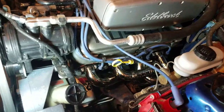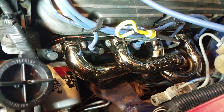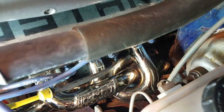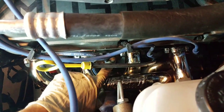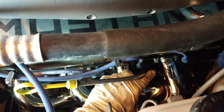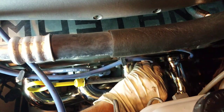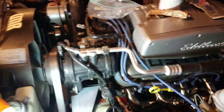We are done on the driver's side — headers all bolted on, got the new plugs and wires, and the dipstick on there. Everything fit well. Once we loosened up the H-pipe underneath, we were able to get it lined up. We'll wait to tighten up all the exhaust underneath until the other side is on. Just a heads up — on this side your ratchet and socket barely fits, but it does fit. Same with the one where the dipstick is. It's tight, but you can fit it on there, so you could change the spark plugs after this, no problem. It is a little tighter than factory, but you are able to do it.